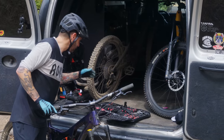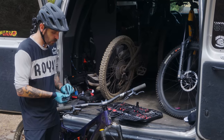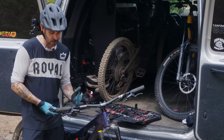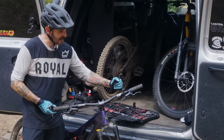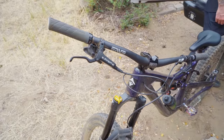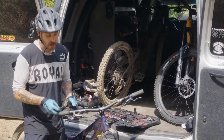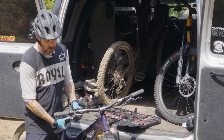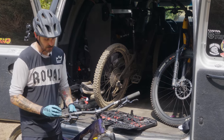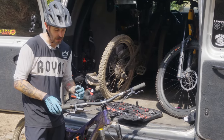Opening up our trusty feedback tool kit to make some adjustments on the brake setup. Our TRP brakes just need a simple four-millimeter allen wrench to adjust. As I said, so many people's brake levers are just smashed all the way to the grip. If you look at the marks on my bars from where I normally run my brakes, they are way inboard. You can have personal preference — different size hands might require in or out adjustments. A lot of brake levers also have a reach adjustment, whether it's a tool-less knob or a small allen, and right now we're going to talk about how far in or out your levers are.